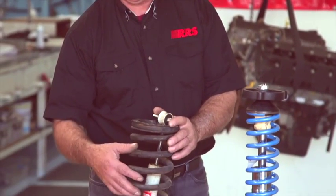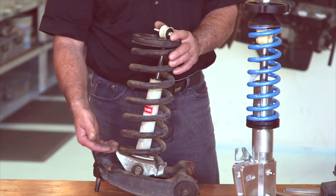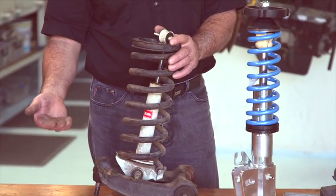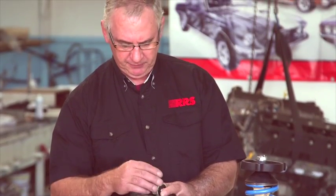The wheel motion ratio is quite different to the spring because it's a lever-mounted spring. Consequently, the spring moves over a shorter range of travel. Therefore the spring has to be at least two times stiffer than the actual vehicle supported weight. Also, because it's moving over a short range, the shock absorber has to dampen this huge spring over a short range.